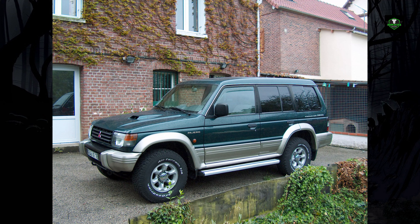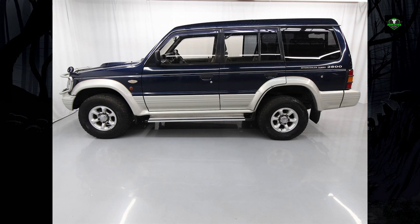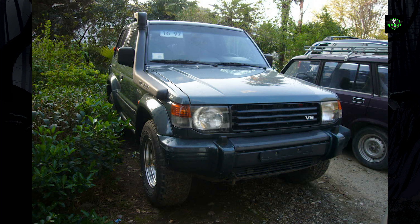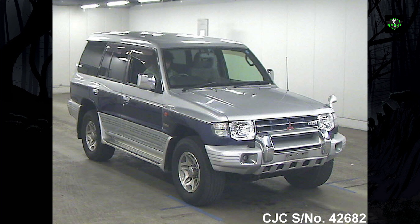The first generation Pajero, which used a traditional 4WD system, had to be stationary to switch from rear wheel drive to 4WD, but not from 4WD back to rear wheel drive. In addition to the SS4, a pneumatic locking differential was included as a factory option. The transfer case is required to be in 4H LC or 4L LC to engage the rear locking differential.